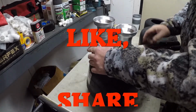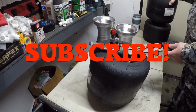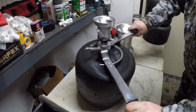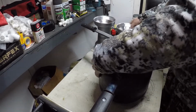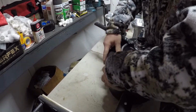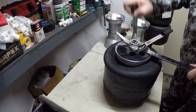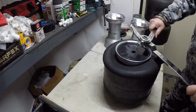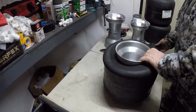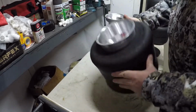I'm putting this down and under the lip, grabbing this pan, put it in. Give me a little room here, and then we start spreading it apart. Alright, and then flip it around. And as I pull, I'm going to push this tire bead under the lip of the wheel, and pop. Simple as that. Well, I wish we'd have had one of these a long time ago. And then I push the tire down, let it kind of even up on the bead.